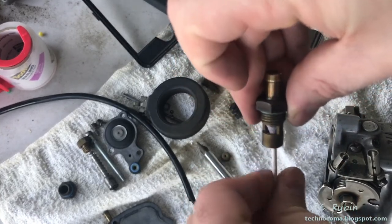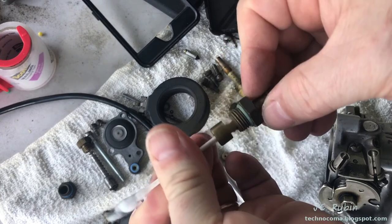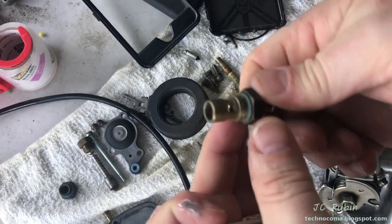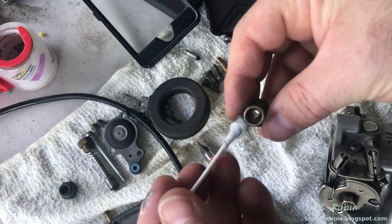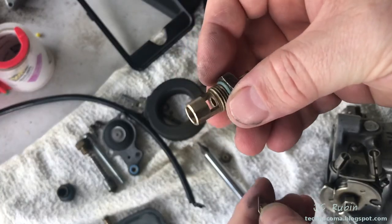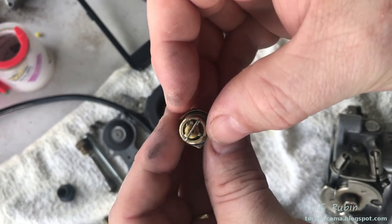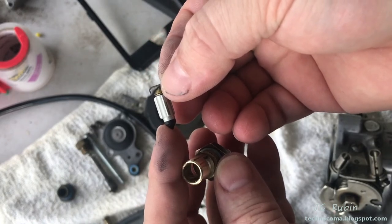It's not a problem yet but it is getting close — maybe this or the next service I may just replace this piece. I'll clean out the actual seat. Still using the metal polish — that doesn't look too bad, just needs a cleaning. This particular piece is not broken but it has seen better days and is about ready to be replaced from normal wear and vibration. This is a critical piece because as it starts to get loose you start to have fuel overfilling in the bowl, causing all sorts of problems through the fuel system and engine. Even if the rubber tip is in good condition, if the sides have sufficiently worn down there may be so much wiggle room that it's only going to get worse.